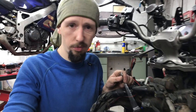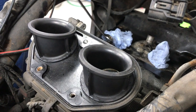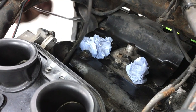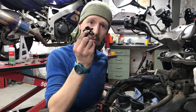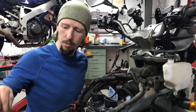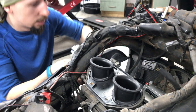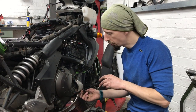We've got a little bit of blue roll or tissue stuffed in the tops there because we've got the plugs out at the moment — we don't want anything falling down into the cylinders. We're going to be removing these top nuts, I think they're 10mm, there are four of them. Just crack them off and then gradually release the rest. There's that little bracket there that was holding the throttle cable — that was proving a bit troublesome but it's now out of the way. I should be able to wriggle this free. And there it is. Inspection cover removal — that's just whatever giant screwdriver-type item you can get hold of.